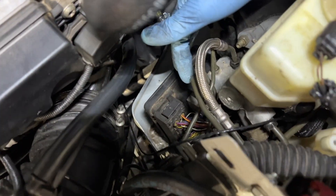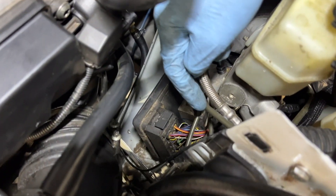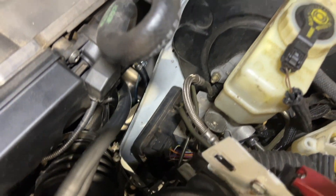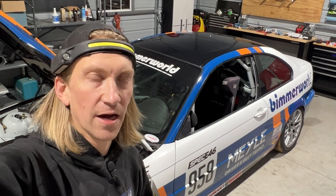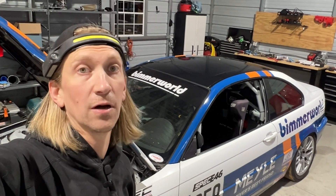Next up is the brake pressure line. I need to get that line off and splice in the brake pressure tap point right here. Before pulling the line apart I wanted to make sure I had my 37-degree flare tool - turns out I don't know where it is. So I've got to find that or buy a new one. I'll hold off on pulling that brake line and work on other things like routing the patch cables and getting the other AiM pieces hooked up.